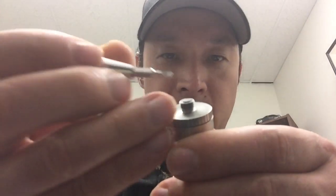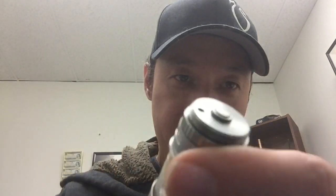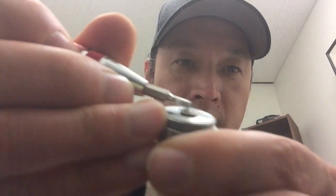This would use the actual pin, the 510 pin, this part here, as your connection to the battery. Bear with me, this all comes together at the end. So this is just giving you bits and pieces of information as we work. Now, you take this part here, you screw it onto your atomizer, like so. So that piece sits, and you can see the 510 part now becomes your positive contact on the battery. And of course you would then just screw that onto your mod, and away you go.